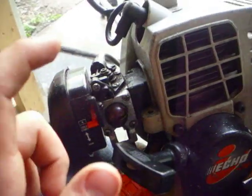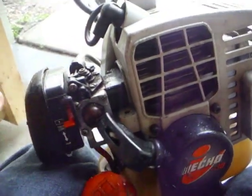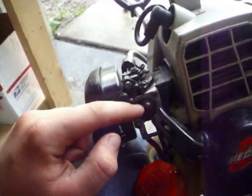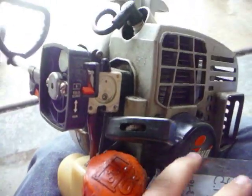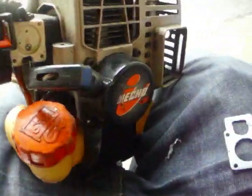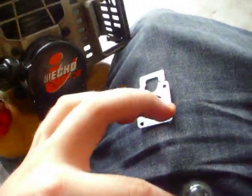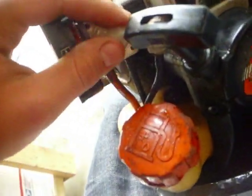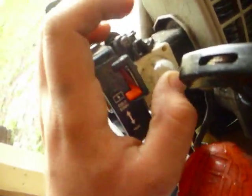First, what you're going to need to do is take off these four screws. You might need to loosen this cover here to do that, but then take off those four screws. You want to get the primer bulb that fits your unit correctly. Here's just a normal primer bulb — this is a common one that I use. This one does fit on there, but not great. And here's another primer bulb that does fit on there very well — pretty much perfect.